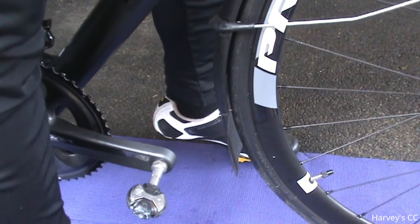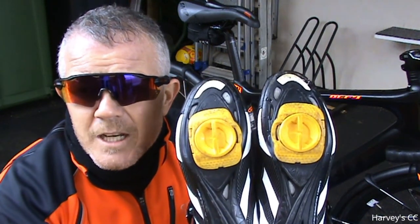I hope that's helped you out with the Speedplay pedals. Remember: every three to four months give your pedals a grease, and every week or every ride dry-lube your cleats — it's the most important thing. If there's anything else I can help with, leave a comment. If you haven't subscribed to the Harvey Cycling channel, why not? We go on loads of rides here in Devon, down to the coast — a fantastic place to ride. Come join me, subscribe, take it easy, and be safe out there — happy riding!